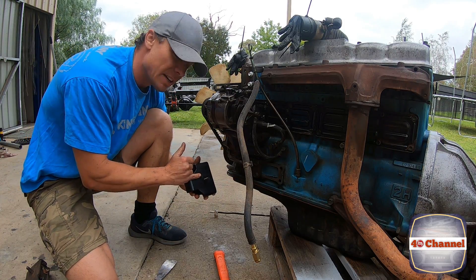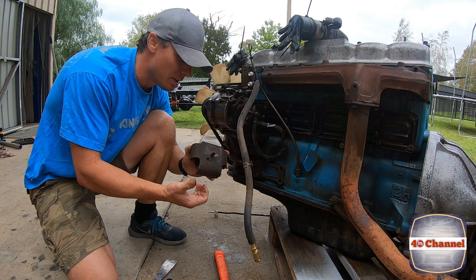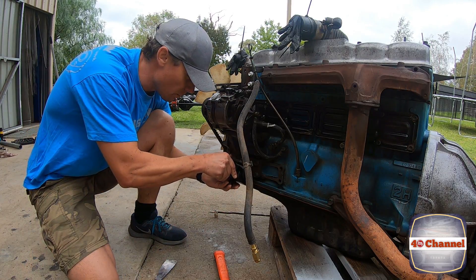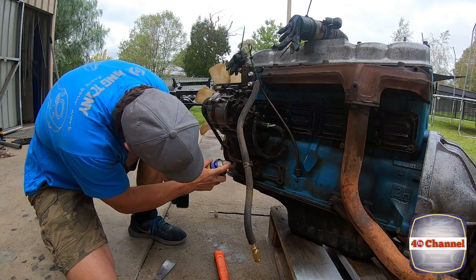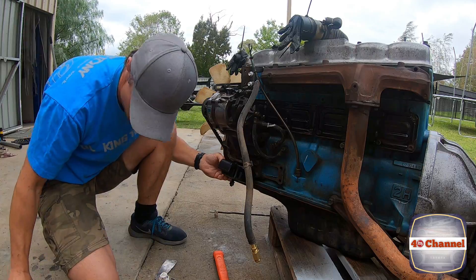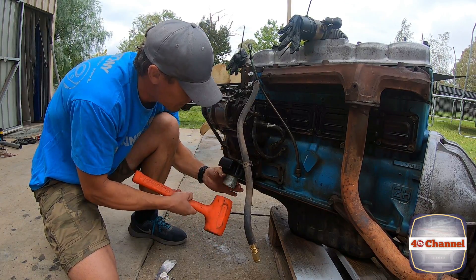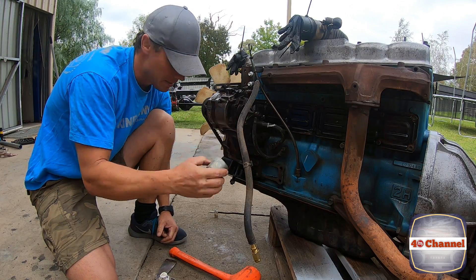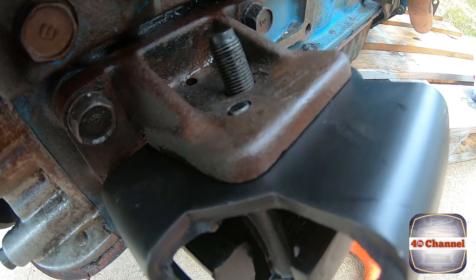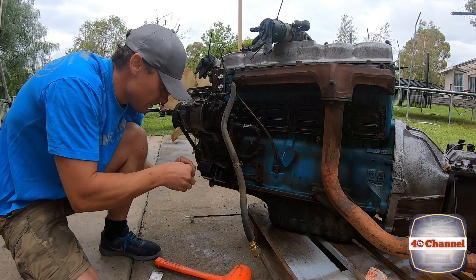Being the 2H it's going to be a bit different to your 2F, but your locating pin gets up through here — it's pretty much size for size. The last owner ground down the top of the pin to get it through, which made it really sloppy and is possibly why there was damage to the old engine mount. I'll give it a quick spray with some WD-40 under there, line it up, and tap it on using a bit of pipe set over the existing thread and bolt so it doesn't damage that at all. It taps right up and sits perfectly in that hole — no more movement or slap, so it can't damage the thread. Spring washer and nut on.